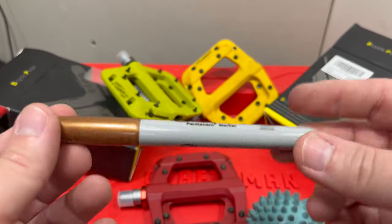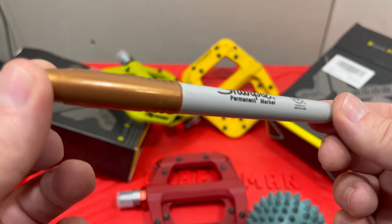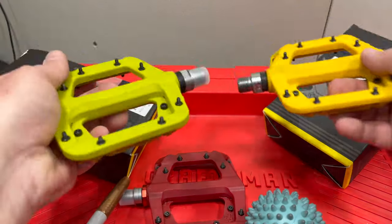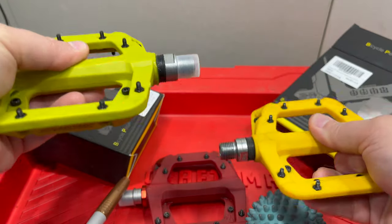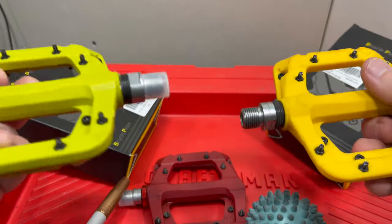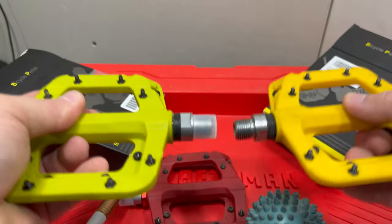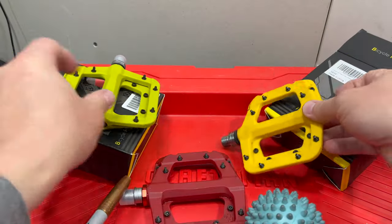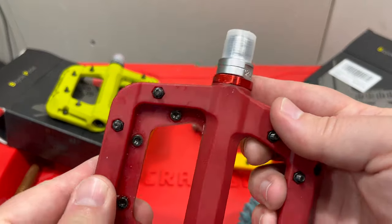That's why engines — like two-stroke engines — use roller bearings or needle bearings on the main bearing. Think about mountain biking: you've got your foot on each pedal and you're putting a lot of up-and-down pressure. The standard pedal works great for that, but if you start getting into really advanced riding with jumps and regular strong stresses up and down, that's where wear can happen, and a needle bearing is going to be a better choice.